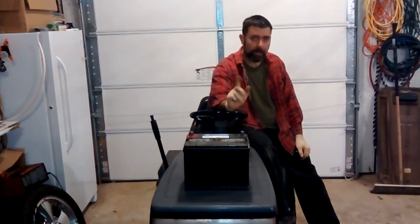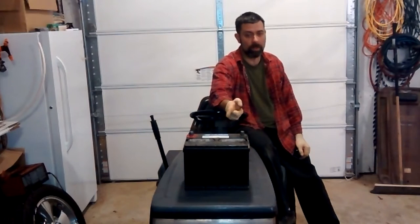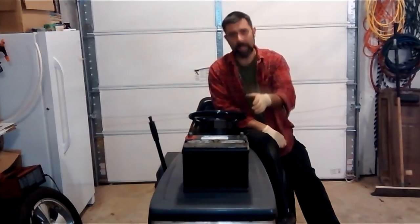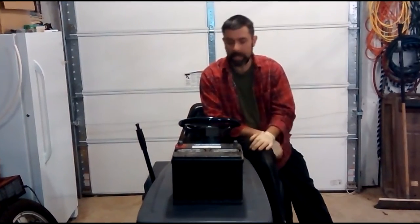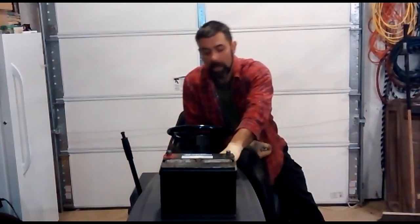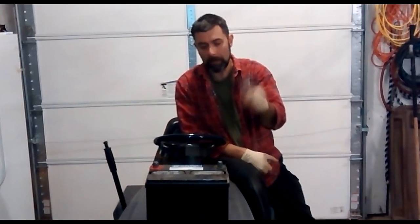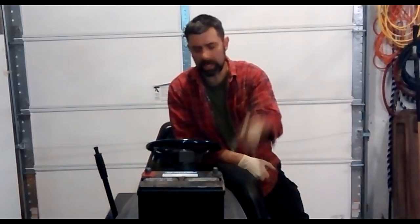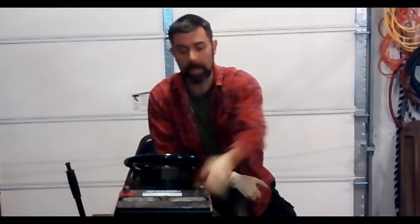The upgrade is I'm going to upgrade this from a lawnmower style battery to an automotive style battery. I have a used battery out of a Hyundai — it was $9. Some core charges are like $7, so let's say $10. The only tools you're going to need to do this job are an 11 millimeter, or the equivalent is 7 sixteenths, and a 13 millimeter, which a half inch will also do the trick. That's the only two tools you're going to need.